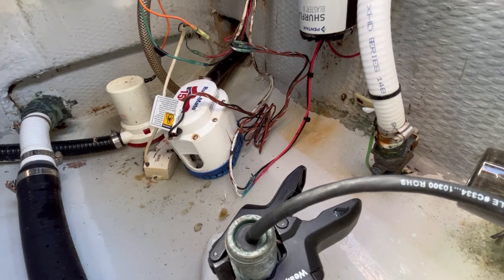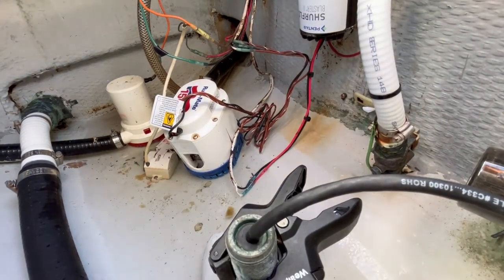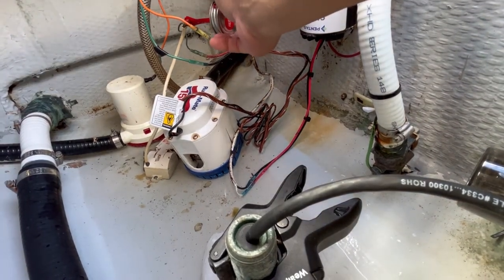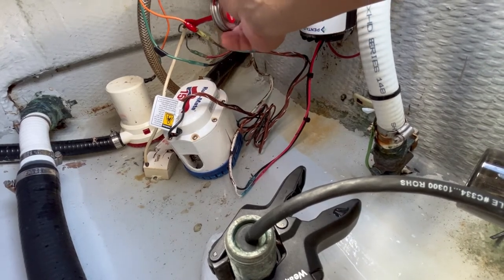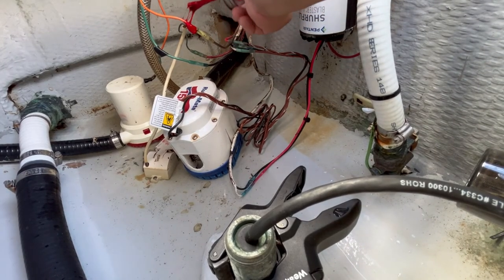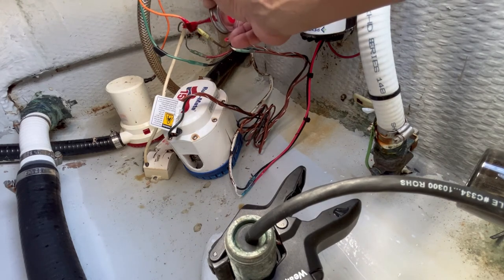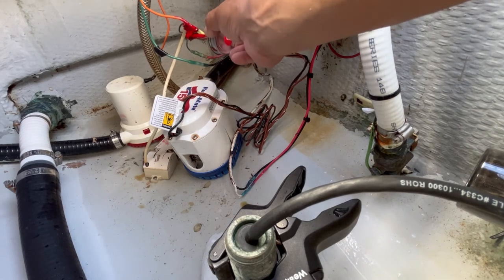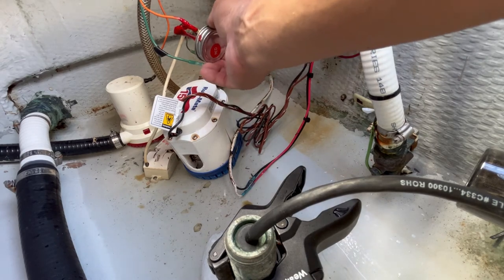Here's another tip: because you have two wires going into one butt connector, you're never going to get a perfect seal. So what I like to do is use a little bit of liquid tape and put it right over the wires, especially where the two wires come together — you always end up with a small gap there. If you can brush it in there and get it in good, it may just help lengthen the life of the wires. You never get as good a connection when you have two wires on the same connector, but I believe this does help in the long run.